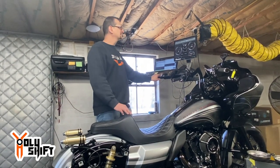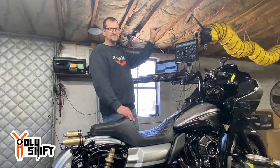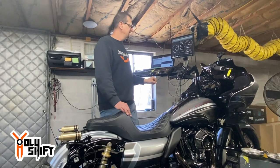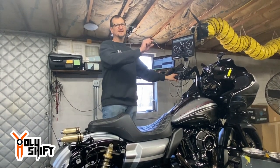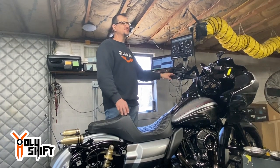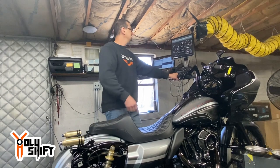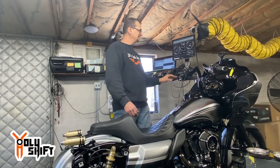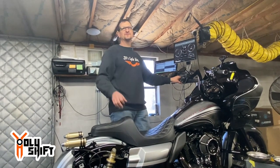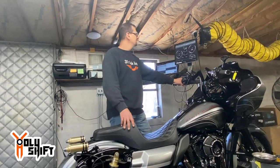But that's why it's good to have, like, you'll see the sheets, they all have SAE in them. Which means Society of Automotive Engineers. It's a correction factor. And if you see one with uncorrected or STD, that's a different factor, and that actually has numbers which are not comparable to what we're seeing. So that's what we try to do in the industry, so I can say, okay, this made this much power here in Pennsylvania versus a guy that made that much power. Like a standard, to create a common standard for everybody. That's exactly what it is.